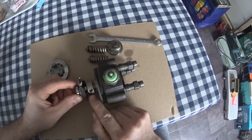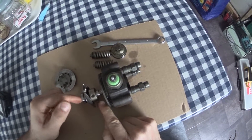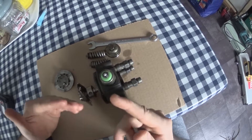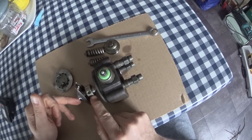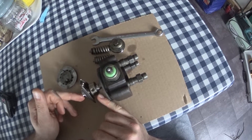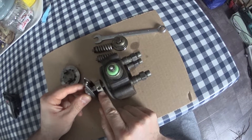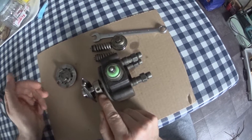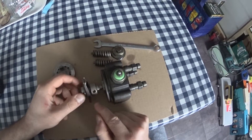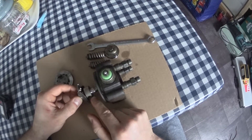As it's coming along and pushing, this is obviously stationary, and that pushes past here. You see that slot uncovered? That is called the spill port. So as it's injected the amount of fuel that you're asking for — here would be quite a lot of fuel — the fuel ceases to go up the injection line and instead spills out into the fuel pump case. If you're asking for more fuel, it's further towards the delivery head, because this has to travel further before it uncovers this port. And if you're asking for less fuel, it's further back, because it only has to travel a millimeter or so — even less than that — before that spill port is uncovered, which then stops the injection.